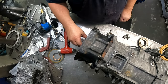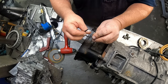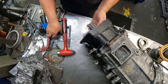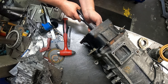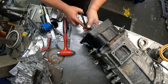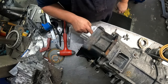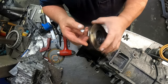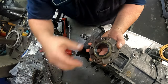Have the thin shim. And the short end of the taper out towards us again. I should have showed it, but I forgot. There's a little notch over here. There's an oiling hole. That's where this is gonna go. I've already pressed my seal in. Put 3M weather strip adhesive on my seals.